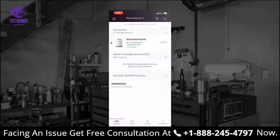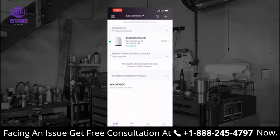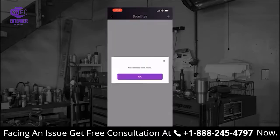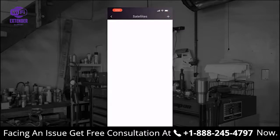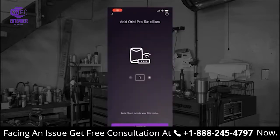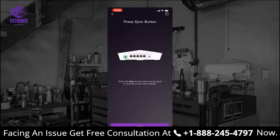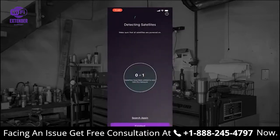First, go to the Insight app and navigate to the Orbi Pro device menu. Second, click on the satellite and click the add button to add the satellite to the router. Once the satellite is synced to the router, you can now unplug the satellite and continue on with the wall mounting to whatever location you prefer.